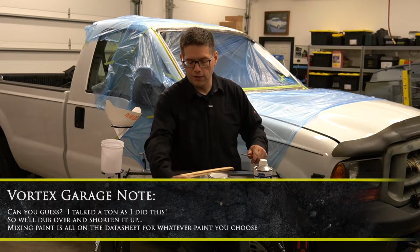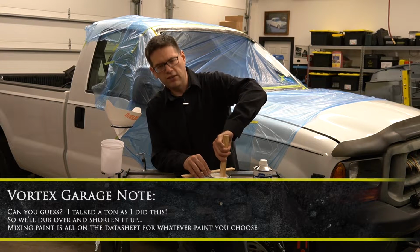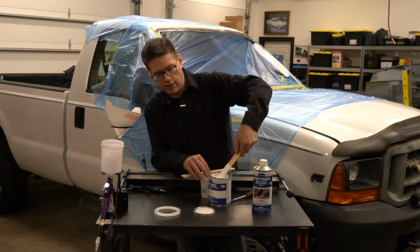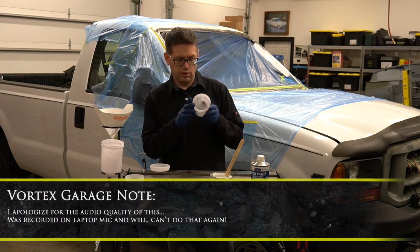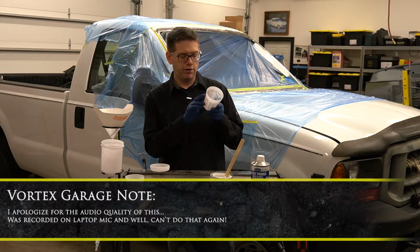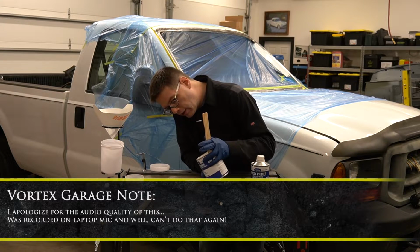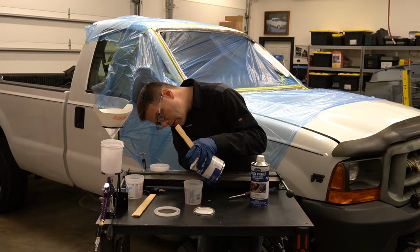Like normal, I found that I talked quite a bit as I went through this, so it made it really hard to edit this piece of the video. What I ended up doing was chopping out the original audio and cutting it up a bit, because you're just going to watch me mixing some paint here. This Eastwood paint mix is 1:1, as I mentioned before. One of the reasons I kept cutting this audio out was I kept saying 2:1. Well, it's 1:1. And the key point is always check your data sheets.